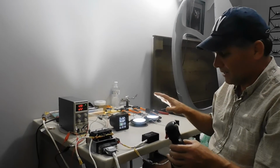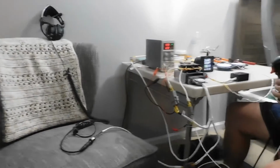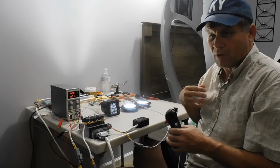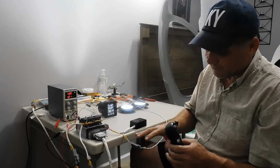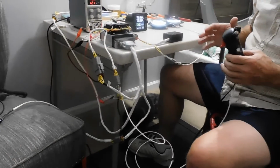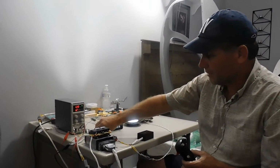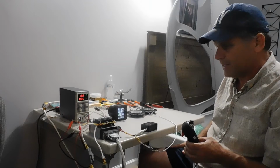So this whole thing, I built the wiring harness borrowing from the factory's schematic diagrams. You kind of have to customize those for your own need, because they didn't come with a helicopter in mind. They're for airplanes mostly. So I could have spent several hundreds of dollars having this wiring harness built, or I could do it myself. And so obviously I chose to do it myself. And you can see I've got a very functional system here that will play out very nicely in the helicopter, and it doesn't take up a lot of space at all.